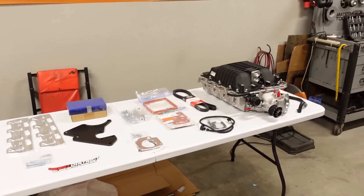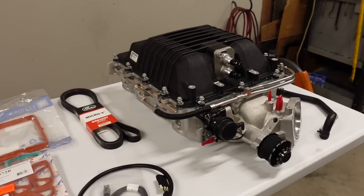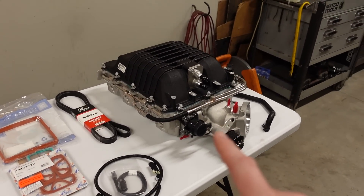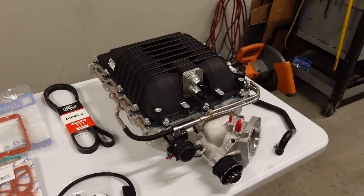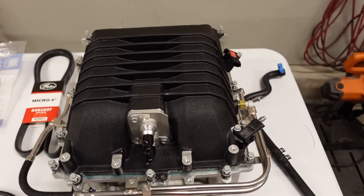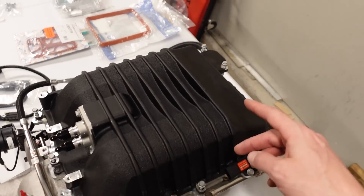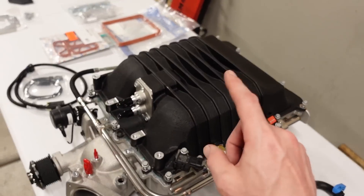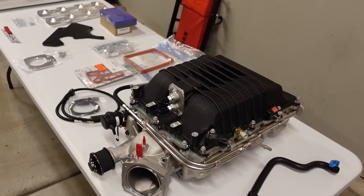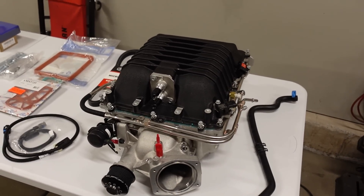The central piece right here is the supercharger itself — this is a 100% brand new GM LSA supercharger. This is a ZL1 lid that comes from the Camaro version, which has the water outlets for the intercooler on the front side. The CTS-V lid has the outlets on the back side. Everything I've read suggests the ZL1 lid flows just a little bit better and offers a little better cooling, and I also just like how it looks compared to the CTS-V lid.